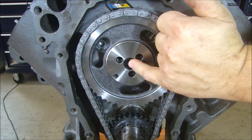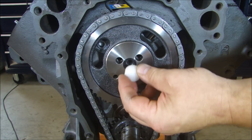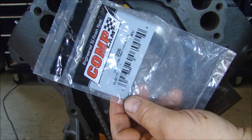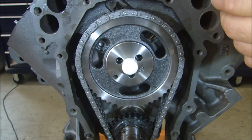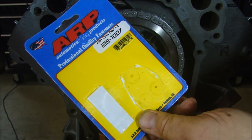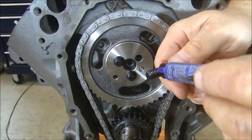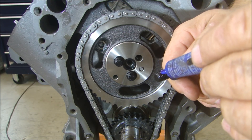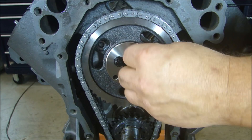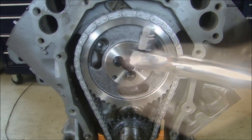The cam button I'm using — you can see that sleeve I got in there for the cam button. You just put it in there and tap it into place. Here's the cam button that goes in there. It's a Comp Cams cam button number 206, and I'm using ARP 129-1007 bolts for my camshaft bolts. Clean off the threads so they're nice and clean, and a little bit of thread locker on there to make sure it doesn't move.